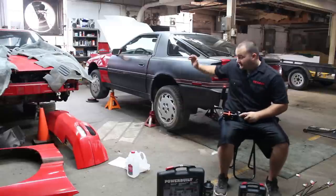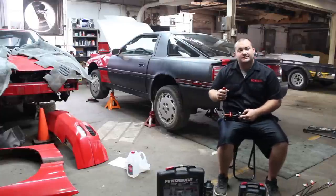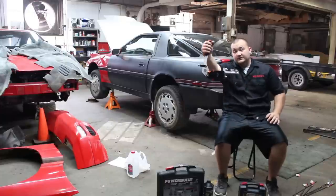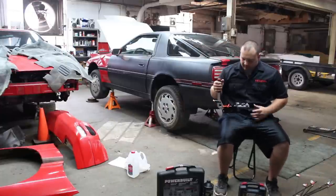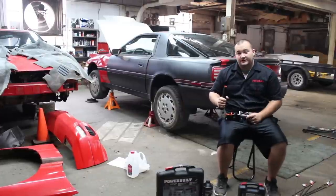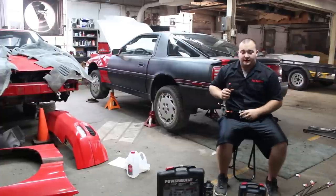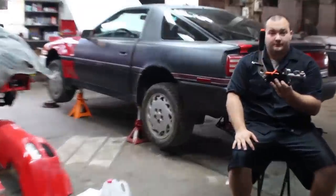So I deleted the shoes, cut the cables, and the only cable left on the car is the one coming into the cabin for the handbrake. I figured I kind of have to have a parking brake of some sort, so I'm going with a hydraulic one that is much simpler, cooler, and even works better. Today is finally the day we're installing this. We have a K-Sport hydraulic e-brake with a little fitting here for the parking brake lever — you just put it in park.